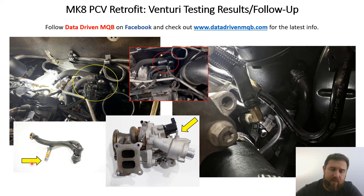Normally, if you haven't been following along, pressure gets pumped from the turbo outlet right here through this hose, across an orifice inside, across the venturi, which generates a vacuum on the PCV system itself — maintaining a vacuum on the crankcase more consistently under more situations.